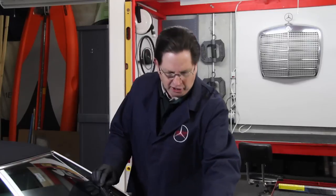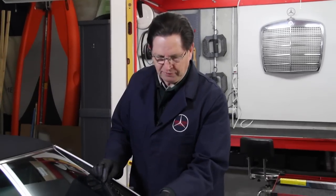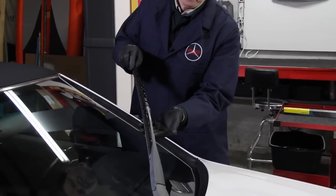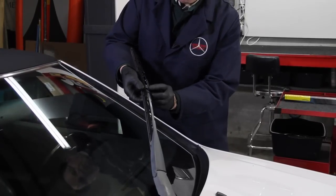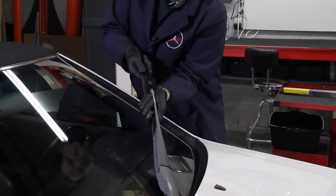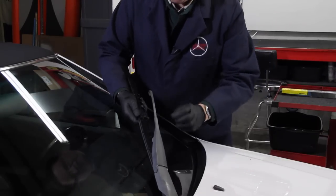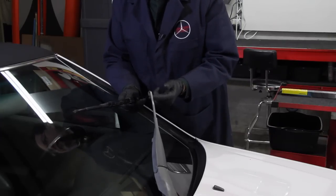The first thing I do on a mono wiper car assembly is to get the blade in a 45-degree position like this. It's very hard to work on blade replacement when it's down in the lower part of the windshield. The way you do this is turn the key on, get the wiper moving, and right where you want the wiper to stop, you turn the key off and take the key out of the ignition. With the wiper in position, I'll lift up on it and you'll hear it click into a position — that holds it off the windshield. Then I push down on this locking tab, push aft on the blade about a half an inch, and pull down on it, and that releases it from this metal arm.